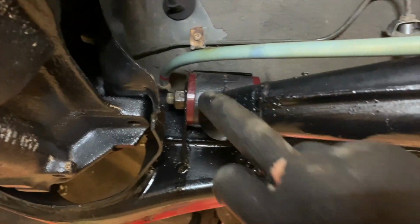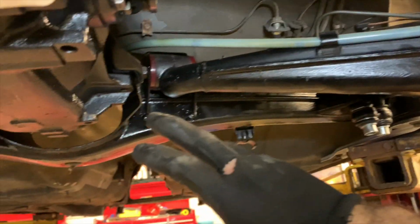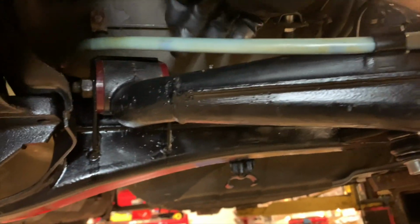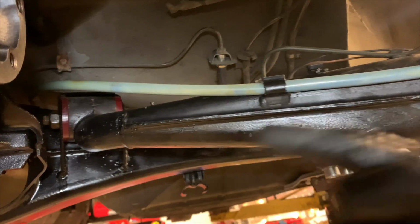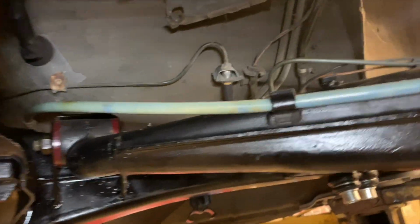Realized here is that I needed to grease these guys in between. If you can see, it is very noisy, and I tried greasing on the insides and the outsides from where the trailing arm is currently sitting on the subframe, and it still squeaks. So what I need to do is take this back apart, and take the sleeves inside of the polyurethane bushings and lube them up on the outside of that and on the inside of the poly bushing, and then reinsert it, and hopefully this squeak will go away.